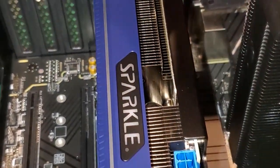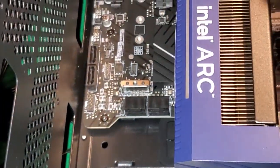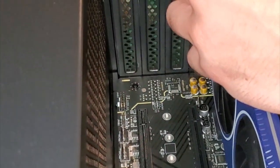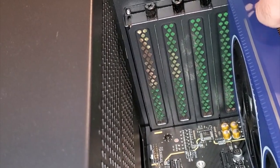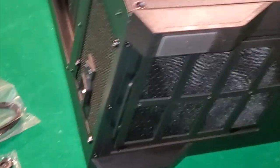What I noticed with these slot covers is they have holes drilled into them. The ones I used to work with were always solid, and sometimes we'd intentionally leave one or two off just so they could get more air into the back. Back in the day these would all have been solid. We also have another slot where we can add more USB ports, but they're only USB 2.0 - that's pretty junky. The front USB ports are what the case offers and the back is what the motherboard offers.